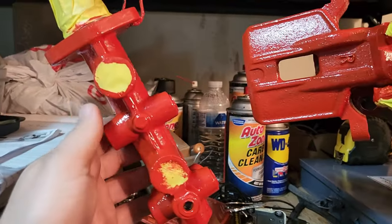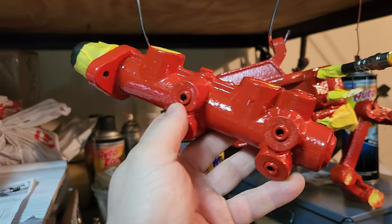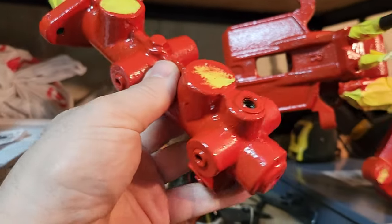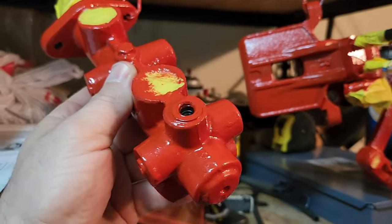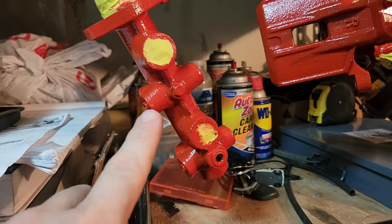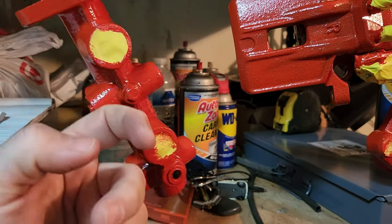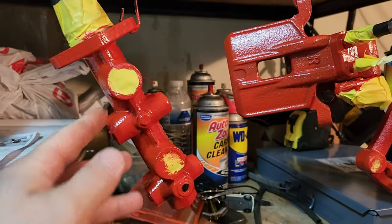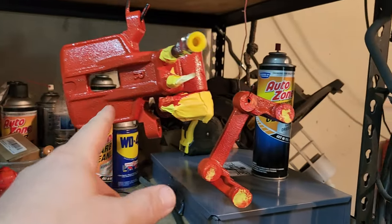All right, so I have a new master cylinder that goes with the whole brake upgrade that I'm doing with the Wilwood brakes. I had a dual master cylinder already, but when I got a hold of Pete over at Air Kewld, guys, he told me that it'd be better if I went with this one. I think it's because it has a larger bore, a larger piston, which helps out with the braking when you're going four-wheel disc brakes.